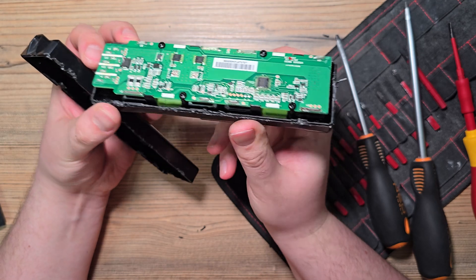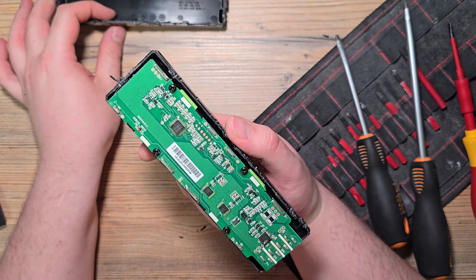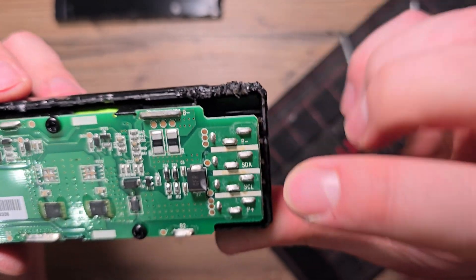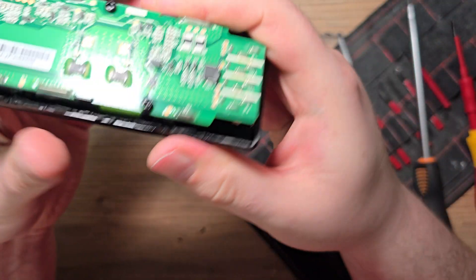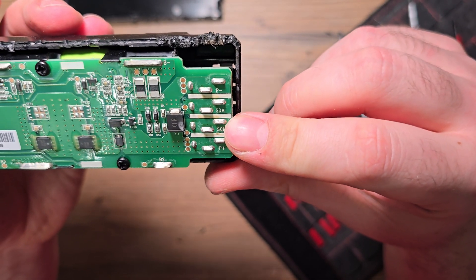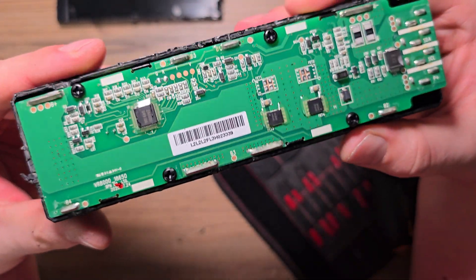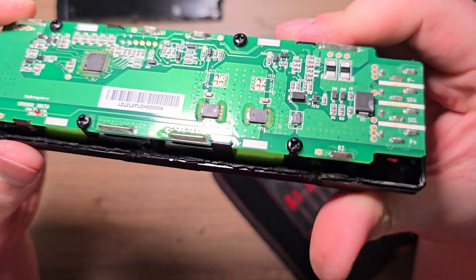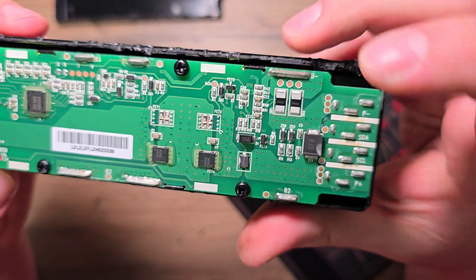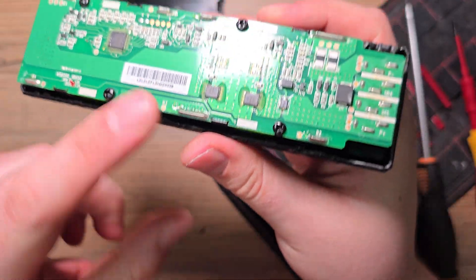There are no clips like in the Samsung Jet vacuum cleaner series. Wow, I didn't expect that. As we can see, there is P minus and P plus marked there, plus and minus. And there is SDA and SCL, so there is I2C communication with the battery. That's how the battery looks like — not a lot to be honest. Just current sensing. Standard battery cells.